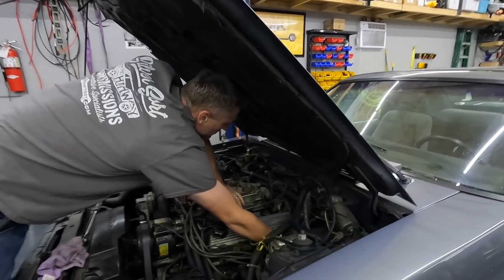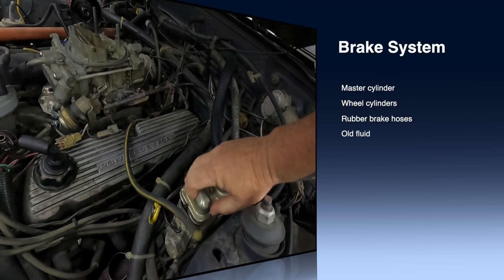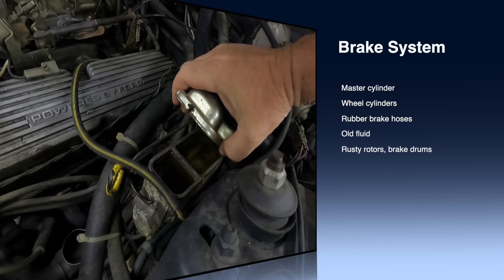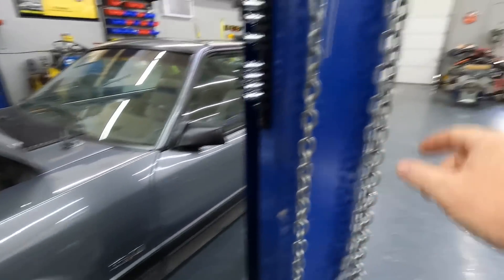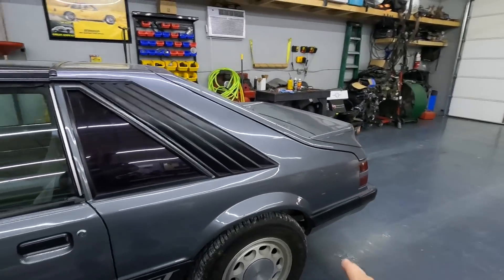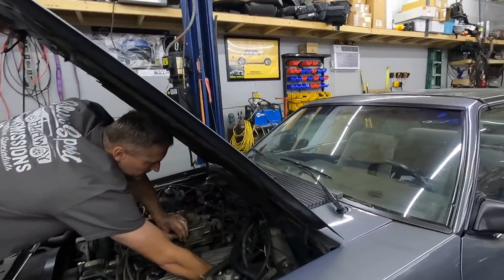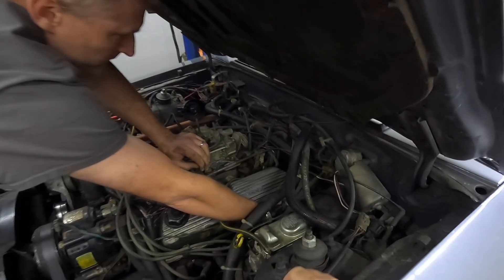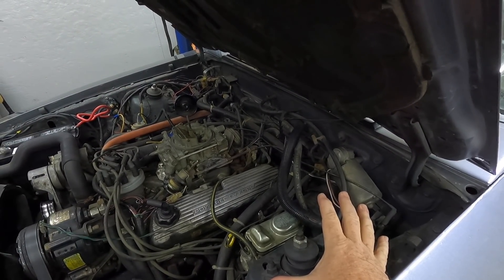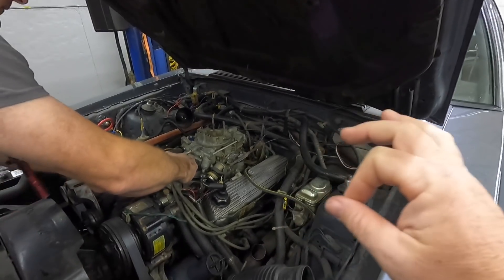Next up: brakes. When we took the master cylinder lid off it had all kinds of corrosion inside and outside — there's a good chance it's going to need one. Brake fluid and all that metal does corrode. Another thing to check: your rubber lines up front and your wheel cylinders in the back — you're probably going to blow those at some point. This car does have brakes but they're pretty spongy. Be prepared for brake line issues, wheel cylinders, possibly the master cylinder and booster — there's a good possibility of leaks and failures there.